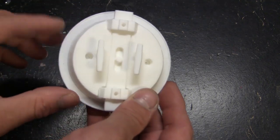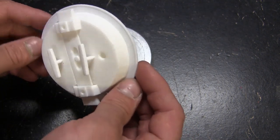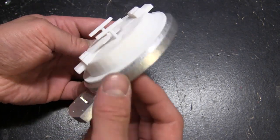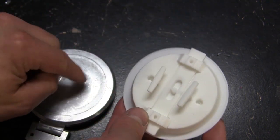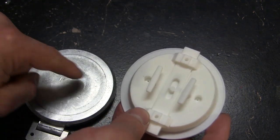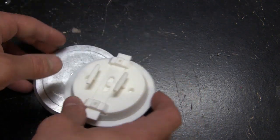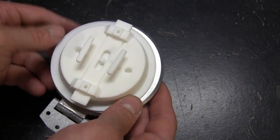This 3D printed component will soon be added to the ECA product line but it's going to change somewhat from the condition it's in here. This one is more or less a pre-production prototype and after seeing it I see some areas to improve upon. Basically what it does is drop directly into place and give you the absent detailing which would have been originally found on the hatch's interior section. The piece is designed to be bolted to the hatch via these two sections — you drill and tap the escape hatch, then thread the unit directly into place. Adhesives alone could work but it's really best used with fasteners, as adhesive after a while can loosen up with the way the hatch clunks around, causing the face to pop off.